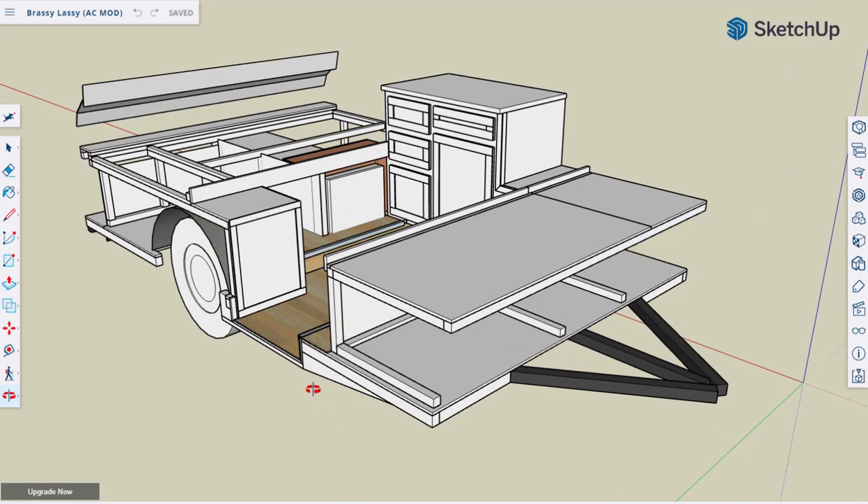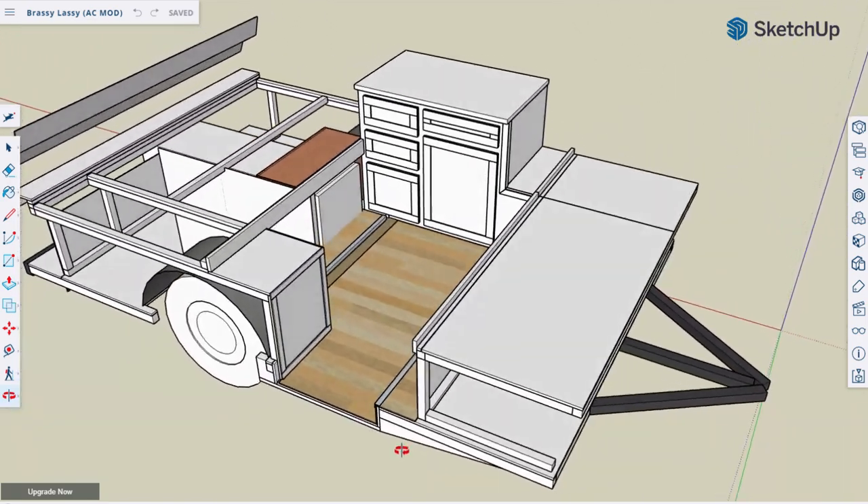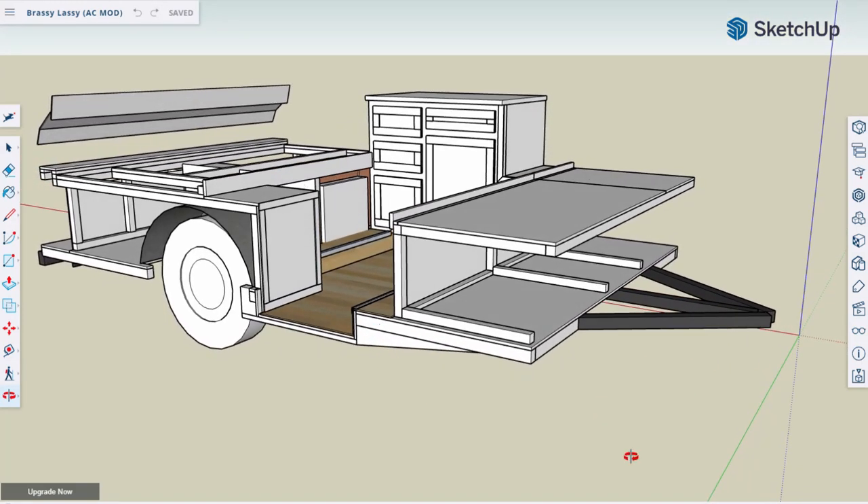This week, hopefully, we'll build our bed frame around it. The first thing I have to do today is find out exactly where that shroud is going to be so I can cut openings in the bottom of the camper to allow cool air to come in and cool the condenser coil. Once I know where the shroud goes, I know where the air conditioner goes, and then I can figure out where the bed's going to go. I'm going to drill a hole in the bottom of the camper.